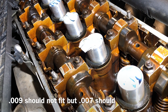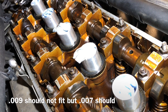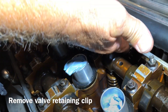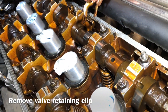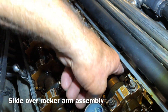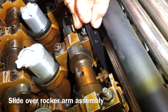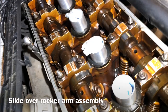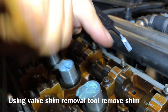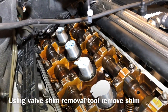I'm going to show you how to pull these little pucks out and measure them, because you're going to find some that are too tight or too loose and you've got to decide whether to get a thicker or thinner shim to make your valve adjustment correct. First thing you do is pull off this little bracket — this little spring clip is what holds the whole system together on this cam. We slide the rocker arm assembly over and now we're ready to remove the puck or shim. The little BMW tool has a magnet — we slide it in and pick the puck right up. This is why we say make sure you plug all the holes — you don't want that in your oil pan.